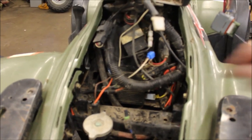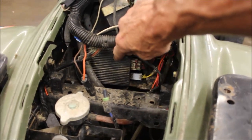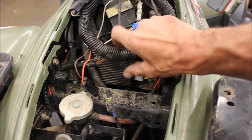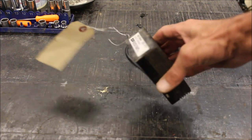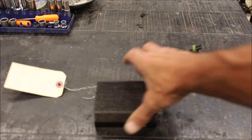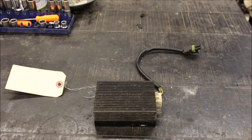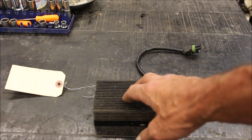For those of you not familiar, the ECM is a little black box right here. Depending what year you have, you might have the silver box or aluminum one — mine just happens to have the black one. What Polaris did years ago was they used the Surepower ECM, and what they did was combine the voltage regulator rectifier, other circuit breakers, and the fan control all in one box.